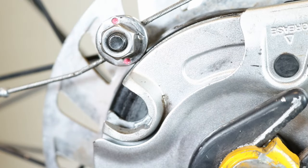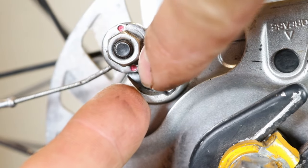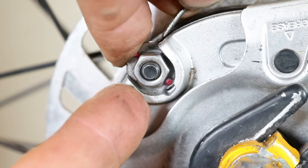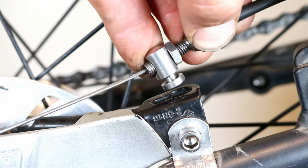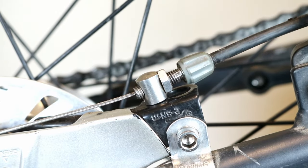Push and hold the winder unit with one hand and with the other, grab the inner cable fixing bolt. Insert the fixing bolt into the groove on the winder unit so that the mark on the fixing bolt aligns with the little groove. Pull the brake cable and insert the outer holder unit into the hole of the brake arm so that it slides into the narrow section of the hole.